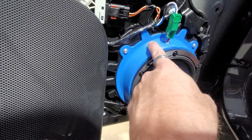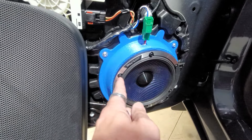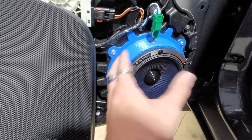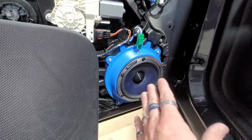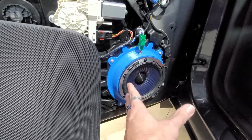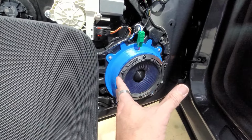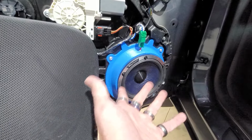I don't feel anything vibrating here. I don't feel any leakage here. So hopefully going from an 8-inch, 7-inch woofer, but an 8-inch outside, down to a 6-inch, doesn't lose mid bass. Now, I've had problems on Broncos, Jeeps, things like that, where we change out the mid bass driver like this, thinking we're gonna get more vocal, and it's set up to be the same thing as this, and I lose the mid bass. So I'm hoping that this works, but we'll see how this goes. I'm not too confident this is gonna make a huge difference. I think the top speakers will, but this, not sure.